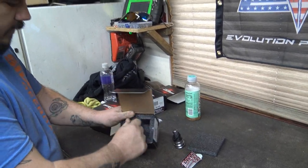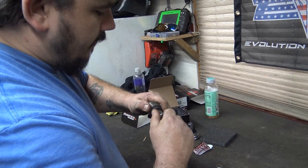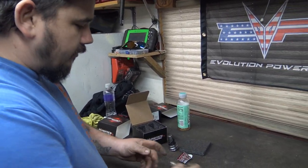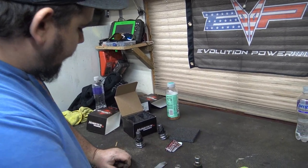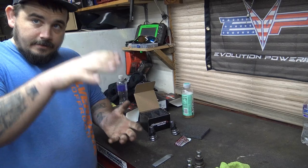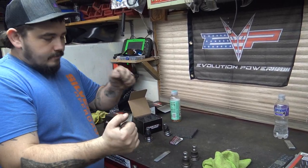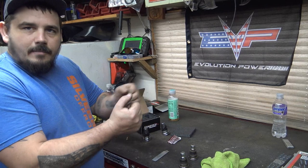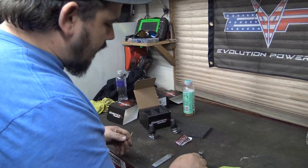Here's something Will pointed out as we were talking off camera. He was looking at these and I can feel a little play right here — one's worse than the other — and I can feel a little play right here. Now these are perfectly good trail ball joints. These are something you throw in a bag and keep them because they're good. Say you hit something, you snap it off, you can throw one back in there. But I showed you how it was kind of pressing, trying to pop out. So you don't really feel a whole lot of leverage here, but when you hit the tire on, the tire works as leverage. The longer something is, it works as leverage. So right now you might not feel a whole lot, but when you grab that tire and move it, that's when you really feel it. So let's say your tire was only this big around — there wouldn't be that much leverage and strain on the ball joints. And if you got 35s on here, obviously you're going to see a lot more play and leverage.